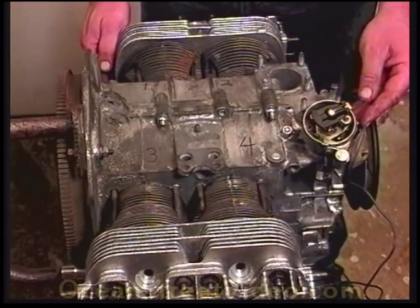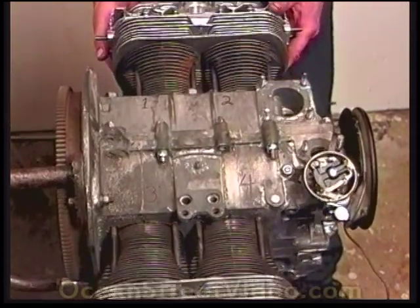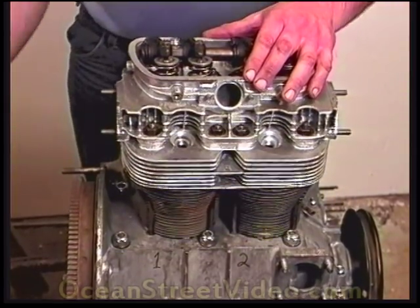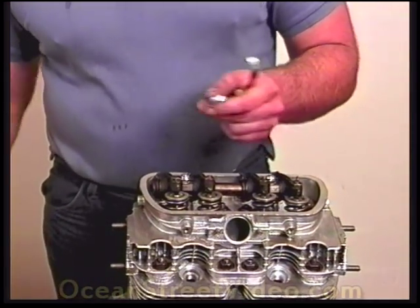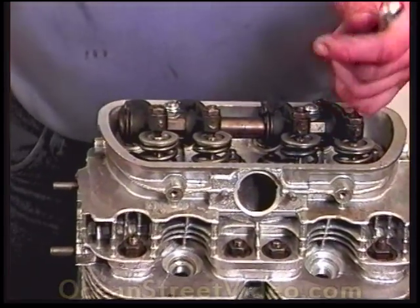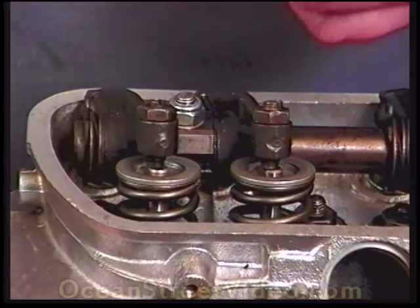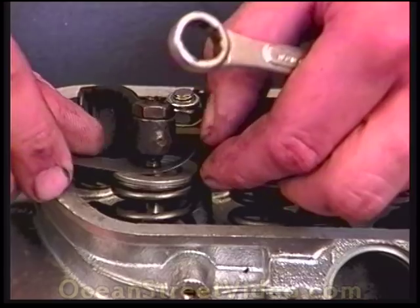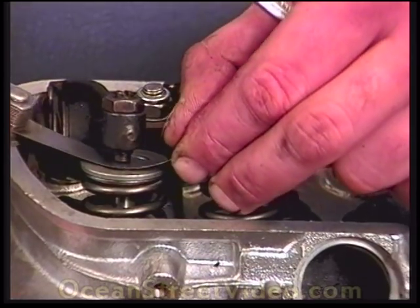I will show you exactly how to do it using the pulley and the distributor. We'll start with number one because we're firing number one right now and we're at top dead center. Using a number six thousandths feeler gauge, a 13mm wrench, and a screwdriver, you can start out by making sure these guys are loose — little 13mm nuts. Back these off a little bit like so, then slip your feeler gauge underneath. Check for tightness and looseness — you want a little bit of resistance.